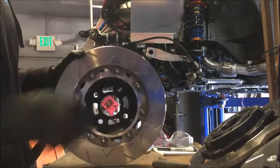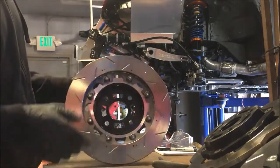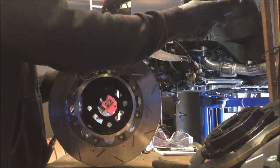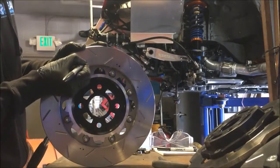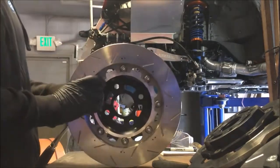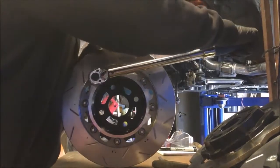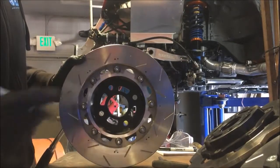It seems like a silly trick to put the Sharpie dots next to each piece of hardware, but you can lose track of it really quickly. I was actually assembling one of the other rotors just a minute ago and torqued one, and then somebody asked me a question. I looked up, and when I looked back I didn't know which one it was because I hadn't marked it yet, so I had to go back and try to feel which one was already torqued. It'll save you a lot of guesswork, and especially it saves you from the potential chance of not realizing you missed one of the eight pieces of hardware and ending up putting the thing on the car without one of the nuts torqued properly. As easy of a mistake as that would be, it could be pretty catastrophic because it is your brakes.